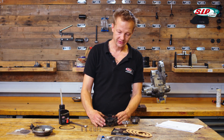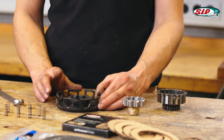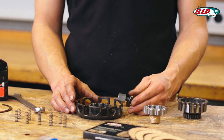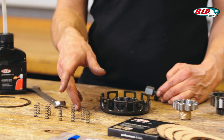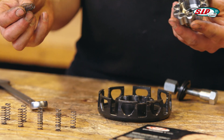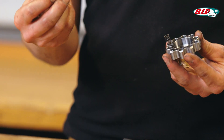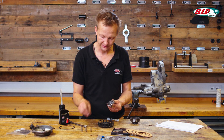For this build I'm going to use a Vespa Cosa clutch from MMW. It is a used one, already seven years old. I'm going to mix harder and softer springs — genuine Piaggio springs five times and also SIP strength L springs, with every second spring being the other type.